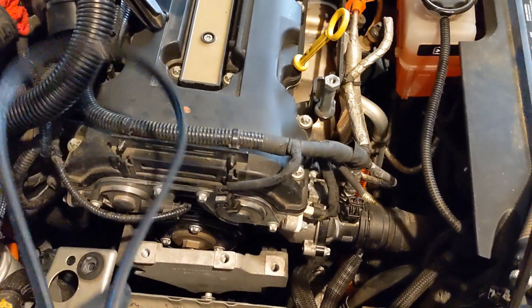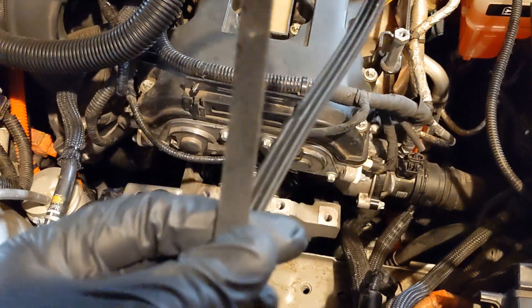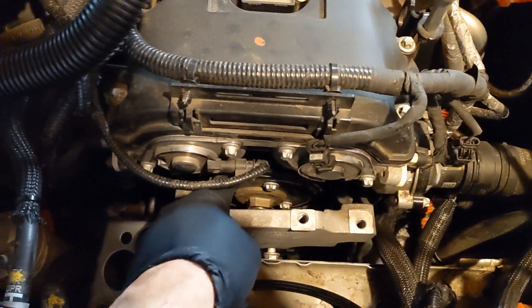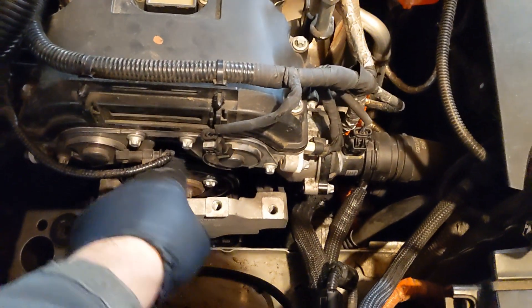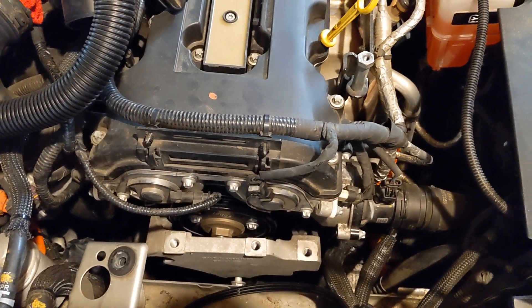From a diagnostic standpoint, the belt looks like it's in really good shape, but it's a stretch belt so I'm not supposed to use it. You can really tell that this is wobbly right here — this totally is the bad part. If you heard the sound, a hundred percent the water pump is bad right there, and you can still smell the fluid in there.